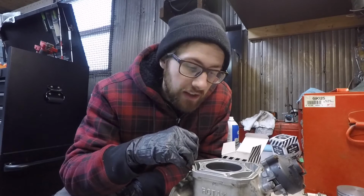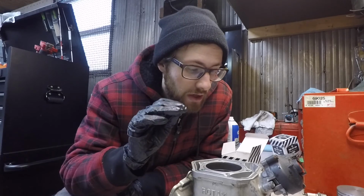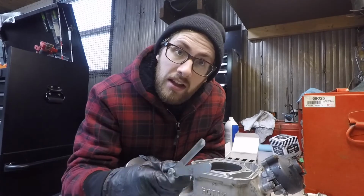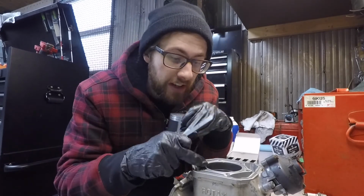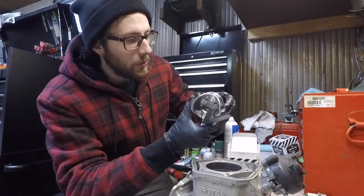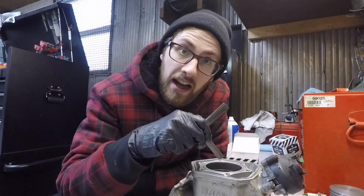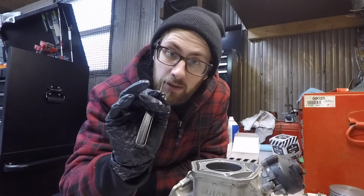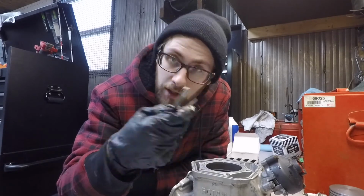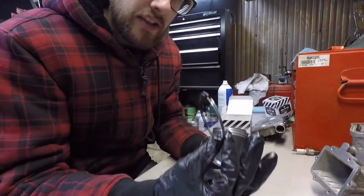So I'm going to do it now. I'm going to give it a quick little grind. I'm going to do it dirty with a file because I don't have the proper grinding tool for the rings. So we're going to try our best to make them square and even, and we'll keep measuring them up. There's a million videos on YouTube on how to do this. I've already got a ring in the bore here. You just put the ring in, put the piston down, square it up because it's got to be square. Obviously you can't have it crooked, it'll throw off your measurement. Stick your feeler gauge down, and then we feel a light drag on it. You feel just grazing the piece of metal here, then you know that's where your measurement is. So you just keep checking, take it out, grind it, put it back in, test it until you get whatever spec you want. So now we got our rings gapped.